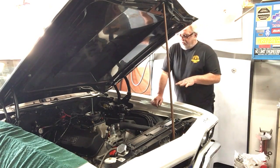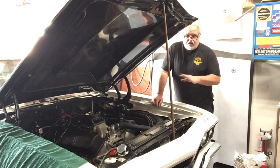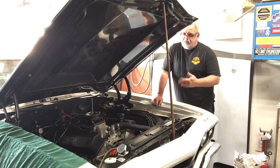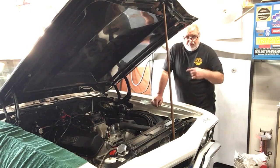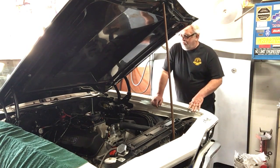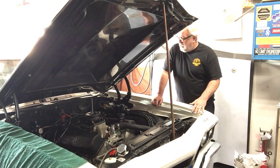It's a full roller motor, so I just let it run long enough to see if we have any oil leaks or coolant leaks or anything — don't want to put too much heat into it. For something like this, the fact that it's a family car and he's been working on it all this time, I'll give him a call and wait for him to come down before we fire it up putting heat in. But other than that, the fuel injection seems like it works fine. The voltage gauge in there was working, the tach was working, so I think it's all good.